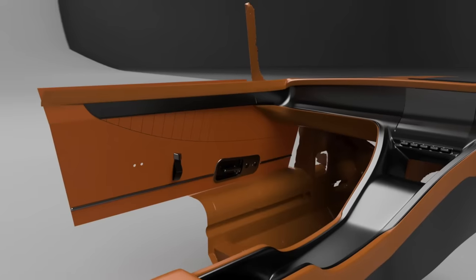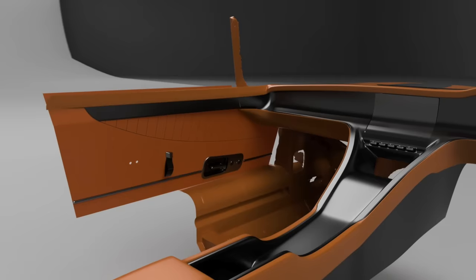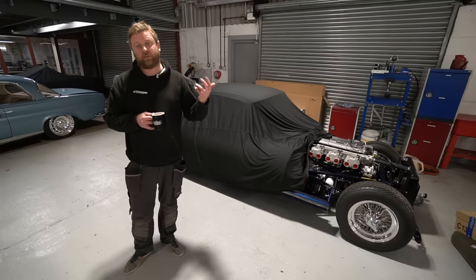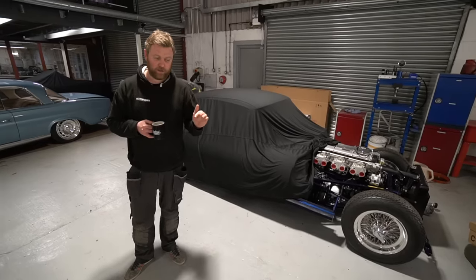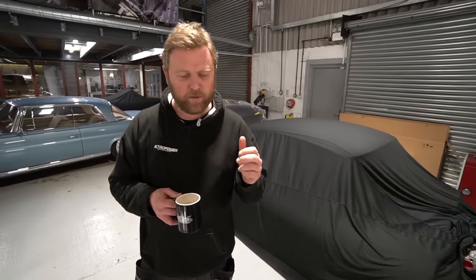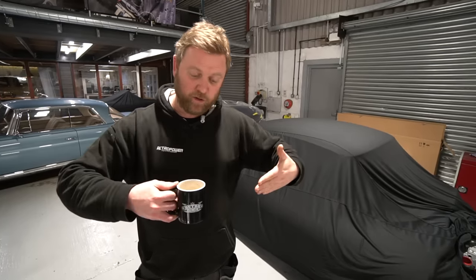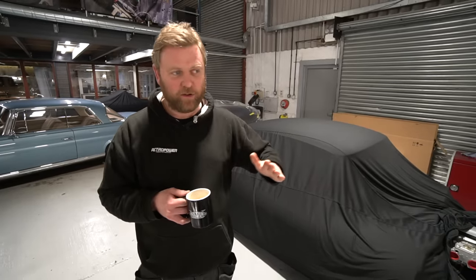For the door cards, we're thinking about a long longitudinal armrest at the bottom that curves up slightly at the back, with the glossy fascia tapering onto the door card but tapering out quite quickly so it doesn't flow all the way to the back. There'll be buttons at the front of the armrest — we're going to have electric windows on this. Unlike the Camaro where we're repurposing window cranks as switches, on the E-type we'll use actual switches, along with a switch for the doors because our plan is to have electrically opening and closing doors with electric soft-close latches. We've also modified the hinge pin angle on a redesigned hinge so that as the doors open they angle upward — a nice party piece where you press a button and the door opens up at an angle.